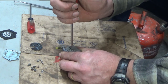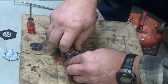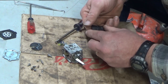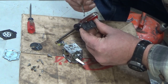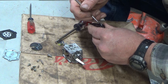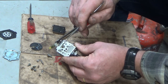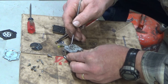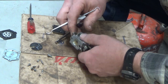So we know that's a problem on this carb. Let's get into the pump side here and see what we have. These are crispy too. These have never pumped fuel — that is for darn certain. And the fuel inlet screen that's supposed to be here is missing. There's a few things here that just aren't cool.